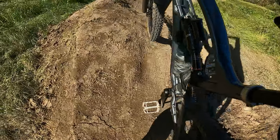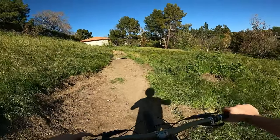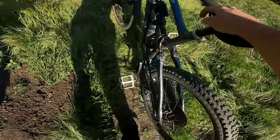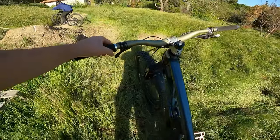The suspension platform is good — it's pretty linear. You can't use a coil shock. I tried with the Progressive coil and I broke the shaft because this linkage system sideloads it. So yeah, you can't run a coil.